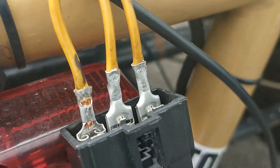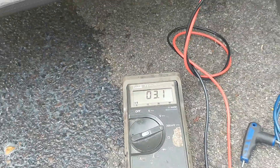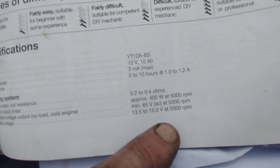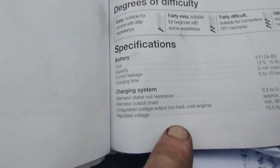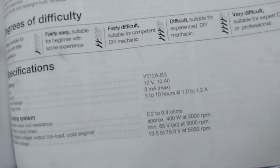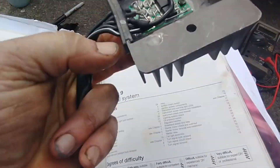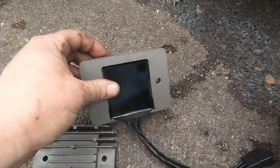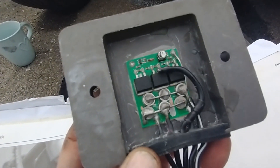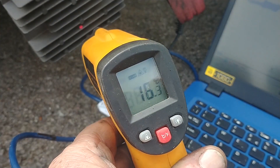Checked the new regulator — I've just lashed up the inputs and put my multimeter on the output. And you should see a nice clean DC on there. The output voltage seemed a little bit high to me, but it is on no load, which is obviously going to make quite a difference. I just looked in the good old Haynes Bible — it's saying thirteen and a half to fifteen. So let's see what it is on load. But I want to test out my possibly fixed one first, because although I think the electronics in this are the same — this is a cheapy — what I'm thinking is if this is now working, I'm going to modify that to make it a bit more robust.